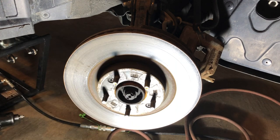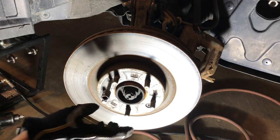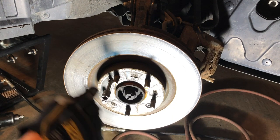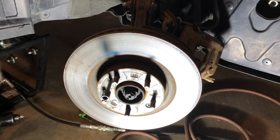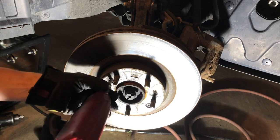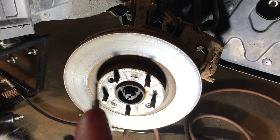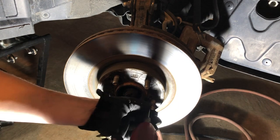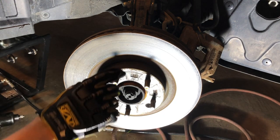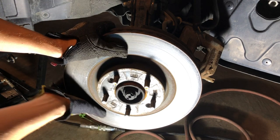Now we're going to take the rotor off. We have these two Phillips bolts — they look like number three. I have a little adapter that goes on the end of my gun, but there are tools you can get that hammer-twist them out, or you can use a screwdriver; some screwdrivers are square so you can put a little wrench on them and turn them. These set screws are not tight at all — they're just there to hold the rotor. One nice thing about them is when reassembling you don't have to put a nut on to hold the rotor in place.